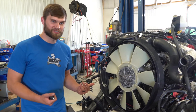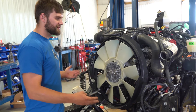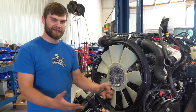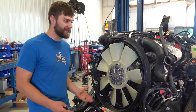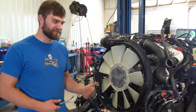How we're going to go about this portion of the build is we're getting a lot of these hoses, clips, wires and everything removed from the frame and bundled up with the engine. We've got some guys developing a stand so we're going to remove the engine from the frame, put it on the stand, and that'll allow us to finish up all our bracket removal, clean up the welds in the frame, and handle reassembly of our new brackets and welding before we get the frame painted.